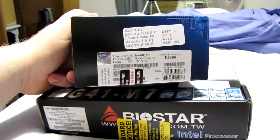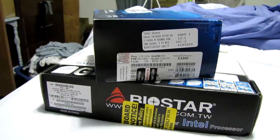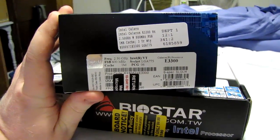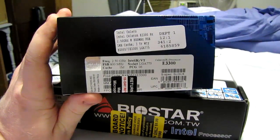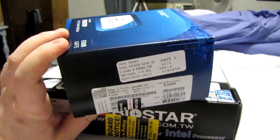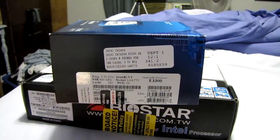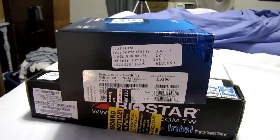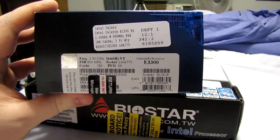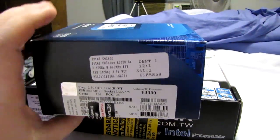I'm hearing stories that routinely on stock voltage — which should be fine for this board since it likely has no CPU voltage adjustment — you can bump the front side bus from 200 megahertz to 233, and that instantly upgrades the CPU speed to something like 3.2 gigahertz. Just a little bump in front side bus speed. That's pretty impressive, and that's not even bumping the voltage. With core voltage bumps you can get this CPU over 4 gigahertz with appropriate cooling. But right out of the box with the stock CPU cooler, 3.2 gigahertz at 233 megahertz front side bus is an easy, pretty much free overclock.